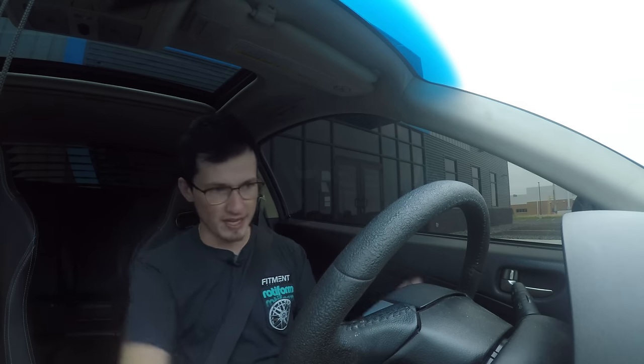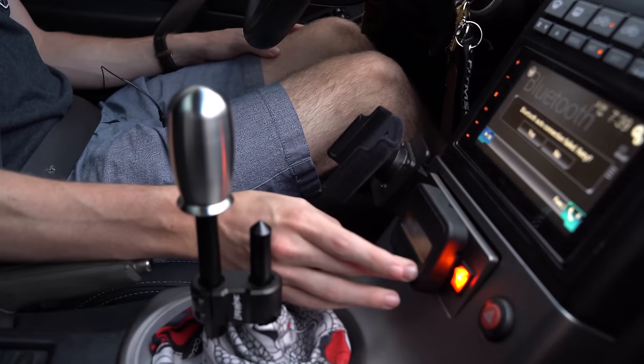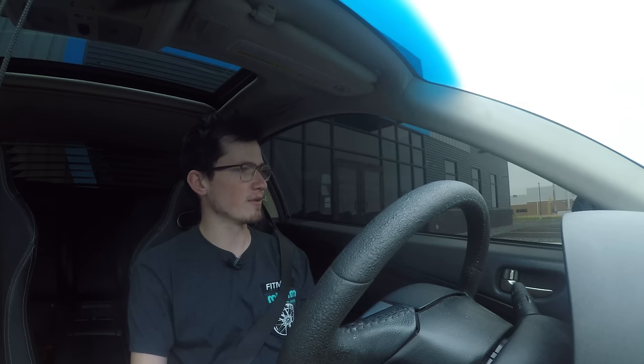First start. One of the tricky things about Junior's car — he already told me — is you have to go flip the switch and then go up to the top right, then bottom right. Because sometimes the rear bags don't pop, and then you've got to get them to pop, otherwise you're going to rub.